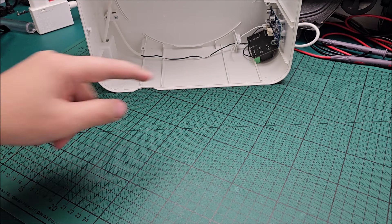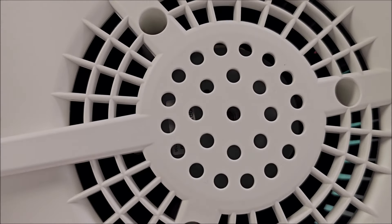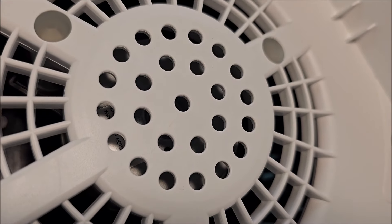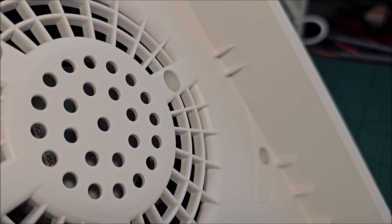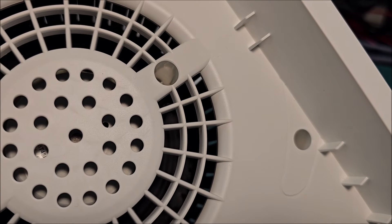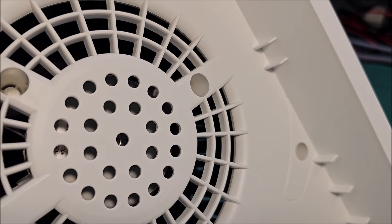First test successful. I will just use hot glue to keep that in place. If you want to take a look at the fan itself, it's this type of fan — it just blows air through here and throws it to the filter. The motor is from zaolimotor.com and I think it's 0.45 amps, 24 volts. The part number is DBT45H4B09.